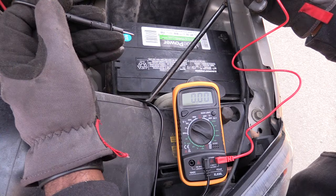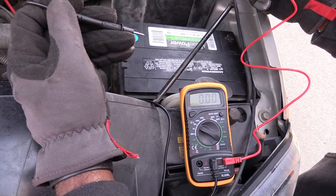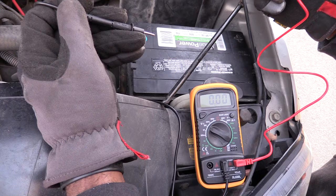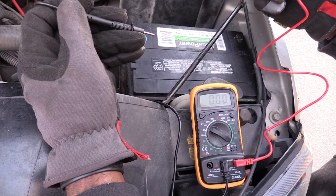This is how you would test your car battery to make sure it's good — by testing it with a multimeter on DC current to make sure it reads around 12.6 volts or higher, as well as testing it in your vehicle to make sure the voltage holds up during cranking. Please check out our other helpful videos, like, subscribe, and share. Thanks.